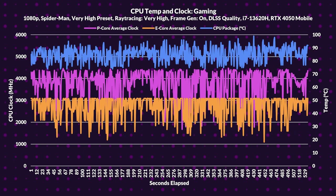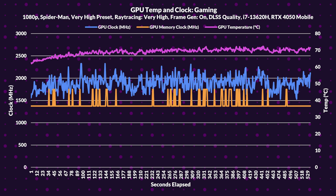Overall, the CPU package temperature ends up at 85°C, which considering the thermal setup isn't surprising. Compared to the Nitro 5 we reviewed it's a night and day difference, even though this only has one fan versus two fans on the Nitro 5. The GPU temperature and clock while gaming was a lot more stable, with the GPU averaging a core clock of 1888MHz while memory stayed at 1413.82MHz, and the GPU core average temperature only reaching around 69°C.